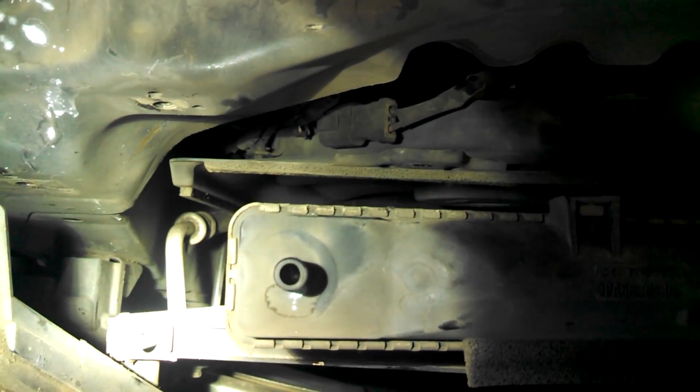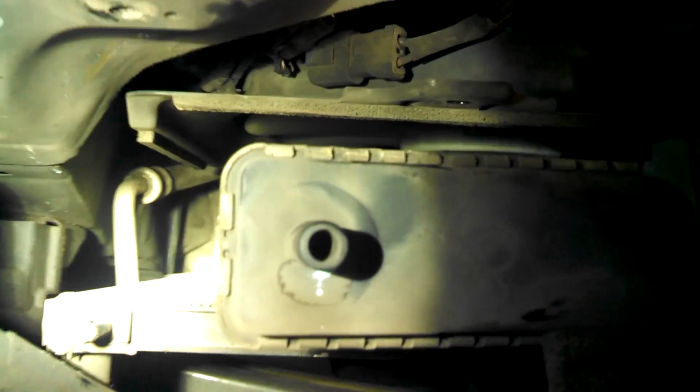I'm going to try and pull the cooling fans back towards the engine a little bit, because we do have to fight over the transmission lines down there, and also the lower radiator hose connection down there, so it could be a little tricky. It might need two people, maybe, just to give you a quick hand. We can pull this condenser out of its holes down there and bring it forward a little bit too, to give you some more space.